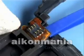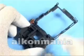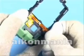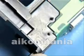Release the flex of the ONE UJ Flash Module, beginning at the connector's side. Now peel up the flex. Release the still-fixed side with the SS93. The module cannot be used again. Check that no residues of the adhesive remain. The disassembly procedure of the lower block is now completed.